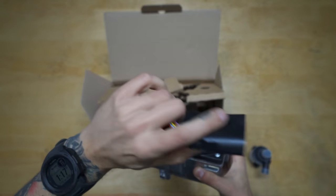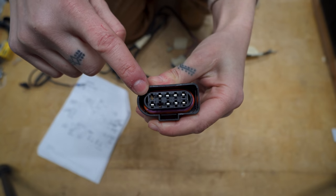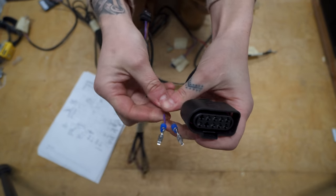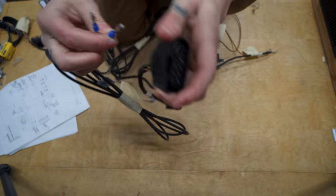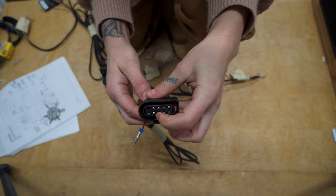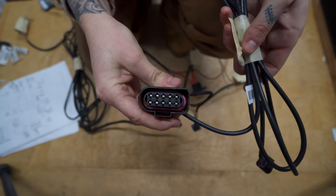The heater itself has a large 10-pin connector attached, which can connect directly to the wiring harness. You'll notice 2 empty terminals in the harness connector, which receives the water pump wiring. Locate the pump harness, which has 2 loose wires, violet and brown, on one end and a black quick connect on the other. Feed the loose purple wire into terminal 8 of the main harness connector and the brown wire into terminal 9. You'll either need a special tool or you can force it with a tiny flathead. Now you have all 10 terminals filled.